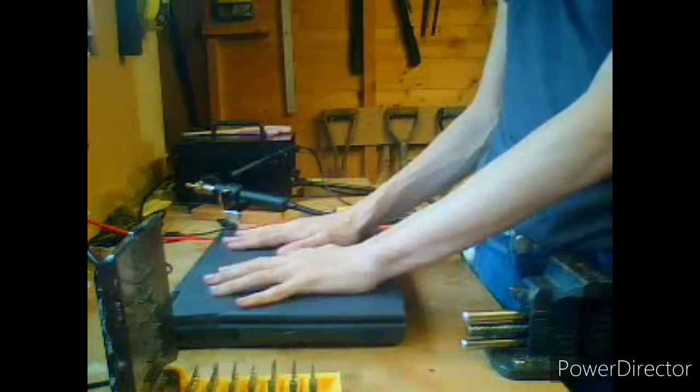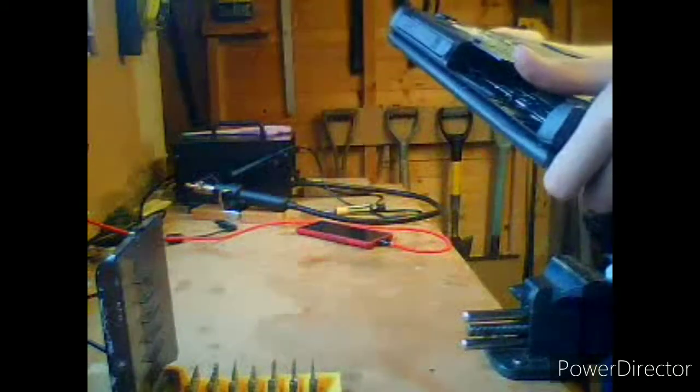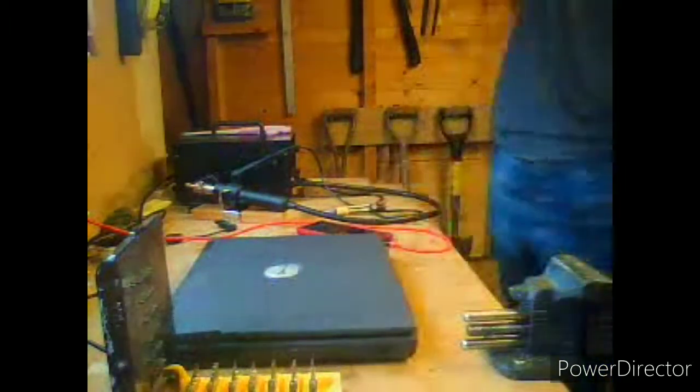Now it's the scary part, which is the testing stage. What have we got? It's 20 volts at 3.5 amps. Now, I don't have the original Dell charger. I've got this SunVision universal power supply. Its DC output says 20 volts, and this says what does it need? It says I need 3.5 amps. I wonder if 3.5 amps is the universal output for chargers.